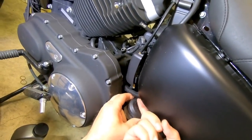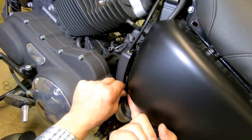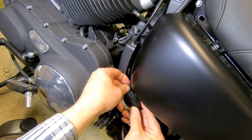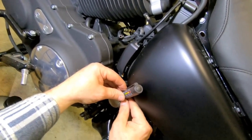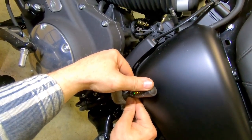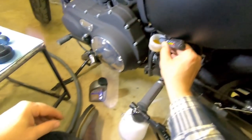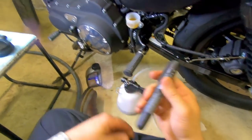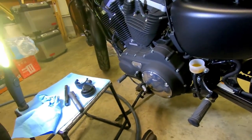The rear will be even quicker yet. All right, with everything handy, make sure your cables and stuff are out of the way because you're gonna have to lift over and the diaphragm may want to come with it. Because you don't want to introduce any dirt to this thing. Look at that — three percent. Am I seeing the four percent light flashing there too? Yeah, she's definitely three percent — definitely time to change. And as I told you guys once before, usually the rear is worse. I'm gonna pause here for a second and put this thing on a stand so the bike is level and I'm not working with it at an angle.